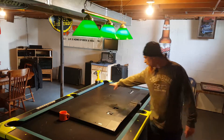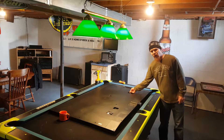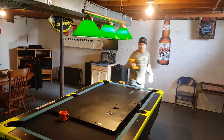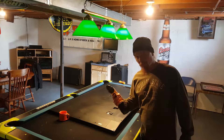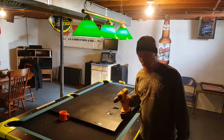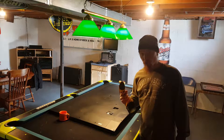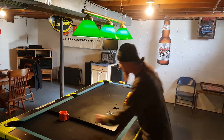There's a whole bunch of screws around the outside, we're going to pop all those out first. Then we're going to look for screws around the video plug-in sources. We're going to throw all our screws just in a little cup. Never use a power tool to put this thing back together — most of these screws go into plastic. I will be putting it back together with a normal screwdriver and not a power drill. Power drill just to speed things up for removal.